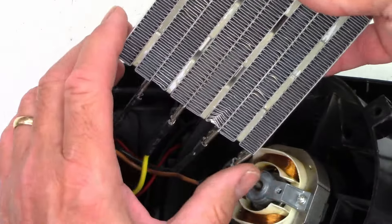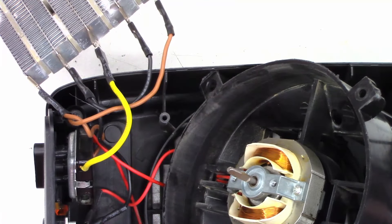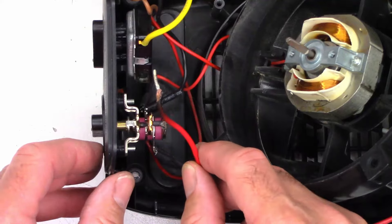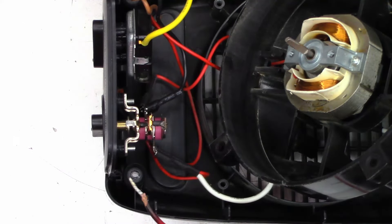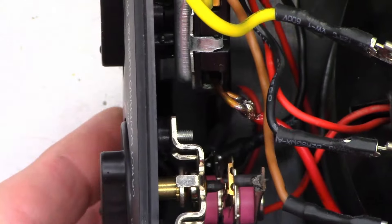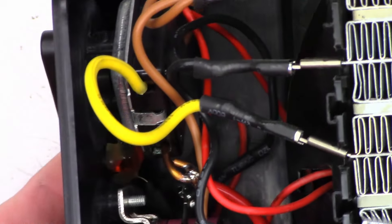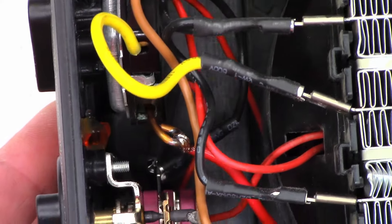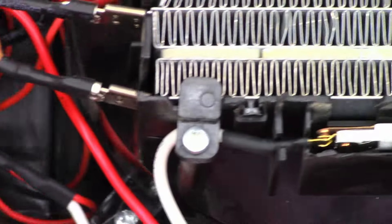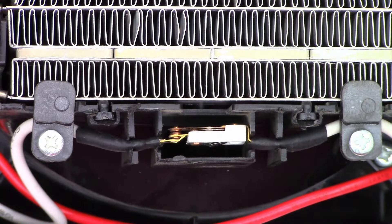I don't think there's any directionality to this — it just goes in there. Let's get this thing all thrown back together. I'm going to strip this wire back and re-tin it like they had it, and plug it back in. I took a piece of 12-gauge solid copper and soldered the existing red wire onto that, then plugged it into the terminal. I worked it around a bunch of times to scuff up the contact, so hopefully that will provide a little more heat sinking. I'm going to run a piece of paper through the contacts and the safety switch, then I think this thing is going to be good once again.